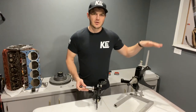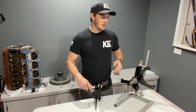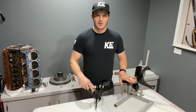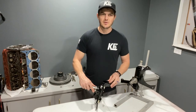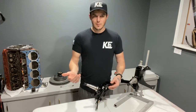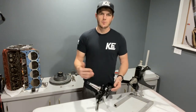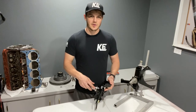I built a jig, and I'll show you that a little bit later, comparing the original drum brakes from the early C10s to other drop spindles on the market and our drop spindle, showing you how ours in real world application is the narrowest on the market. As you go from drum brakes to disc brakes and lower the vehicle, especially with drop spindles, it actually widens the truck out quite a bit. That ends up being a problem with fender clearance issues, especially if you bought wheels and tires before the drop. Ours moves the wheel back inboard quite a lot, as we'll show you here shortly.